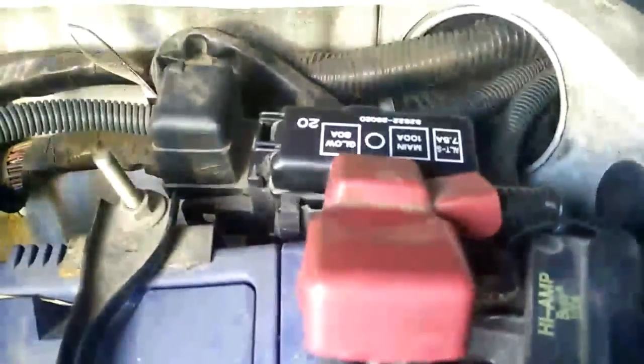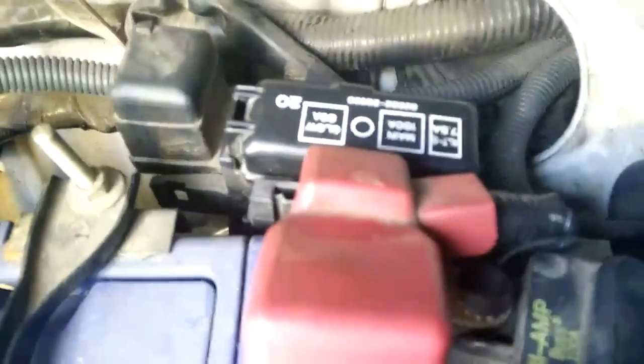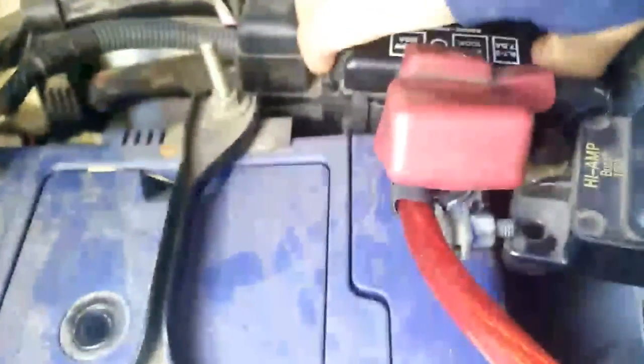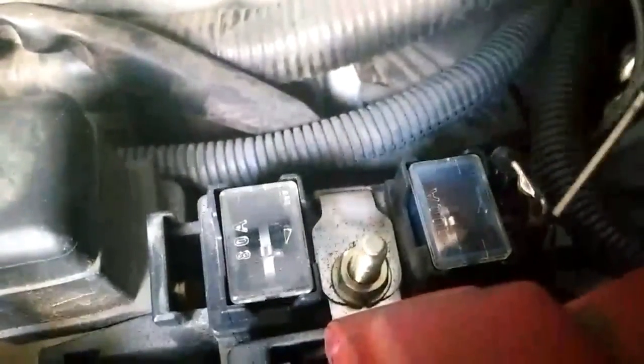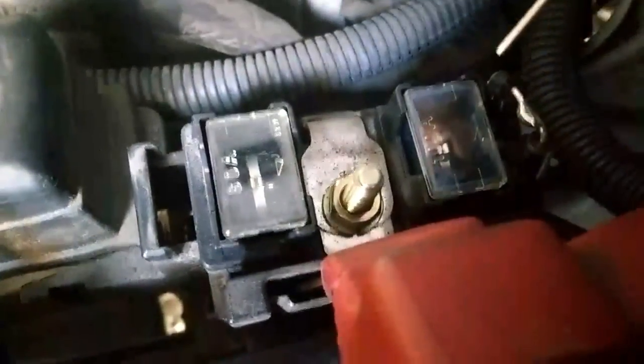Just to show you where the ALT-S fuse is on my Toyota Hiace — it's behind the passenger seat, underneath the engine bay. You can see the battery, then you've got your fuse box. Generally that's your 100 amp battery fuse. On the far right it says ALT-S 7.5 amp, upside down — that is the fuse we're tampering with. You can see I have two diodes: one diode and the other diode bent 90 degrees, and I've just pushed them into the fuse location. The fuse slot is just a normal bladed fuse type.